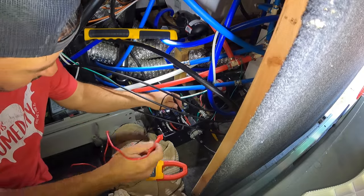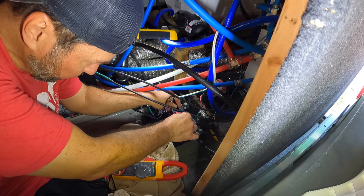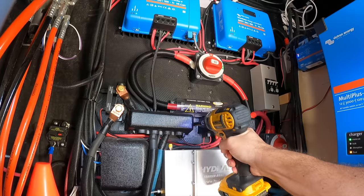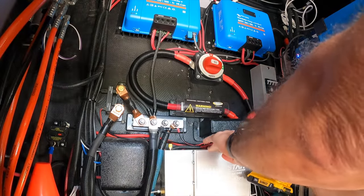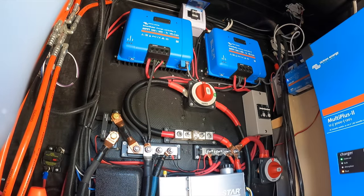Safety first — definitely turn off all of your power and disconnect your batteries. You want to be safe when working on electrical stuff. If you have a volt meter, even after disconnecting your electrical, test it just to make sure. Maybe you've got an inverter hidden somewhere — you want these to be dead circuits. If you're even just 1% unsure, turn off all power.